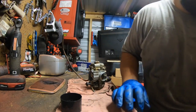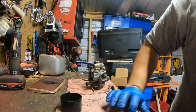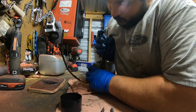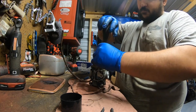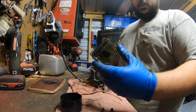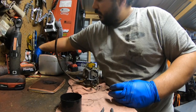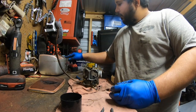If you have a bolt that's stubborn, we have two options that we normally use: small baby pair of channel locks and a pair of dykes. Dykes, grab it from the head like so and actually cut into the head, and then there you go. Okay, you actually see it's pretty gummed up. A lot of green in there, corrosion, smells absolutely terrible. We're gonna go ahead and plug the ultrasonic cleaner in and get the temperature to come up.